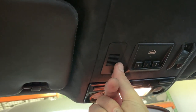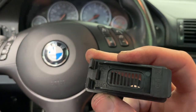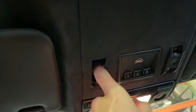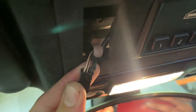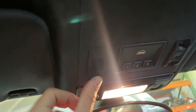There's a better way to tell — this little thing just clips in from the front. Get some fingernails in there and pull down, and this whole little cover comes out. You'll see that there is indeed no microphone here in this car — the microphone actually installs into this cover. You'll see a clip and a groove back there; when you have the microphone in hand it's very simple to see how it installs. All of these cars are pre-wired for the microphone. You may need to remove the rest of this paneling — the light pries down from the front and you can let it hang by its wire, then push the entire Alcantara panel down out of the headliner. You'll find what I believe is a three-pin connector — there it is, loose — with three wires, one of them in a black shield. You plug your microphone into that, snap it into the grill cover, and replace the whole thing starting from the front and pop it back into place.